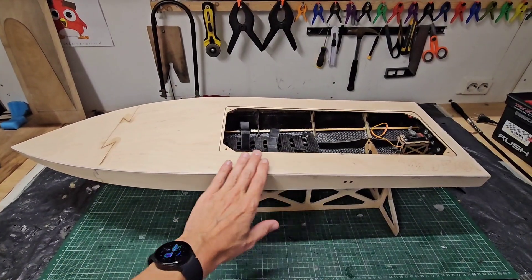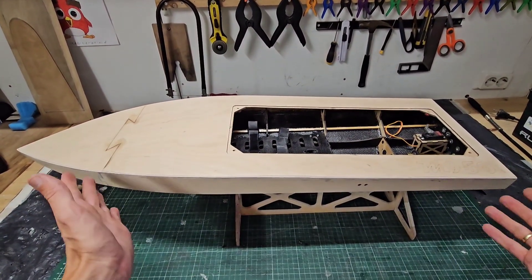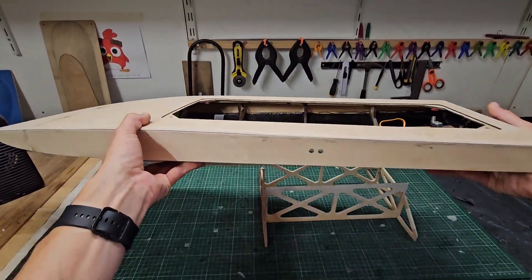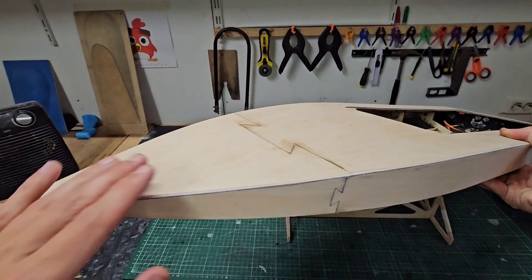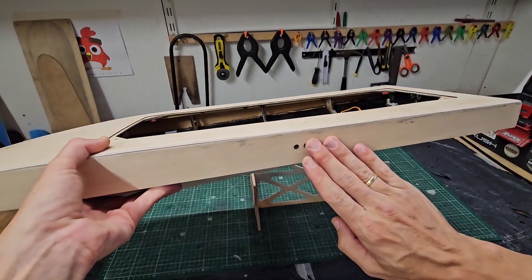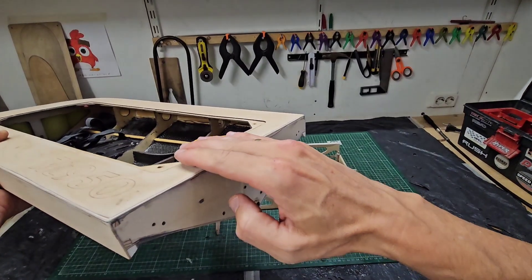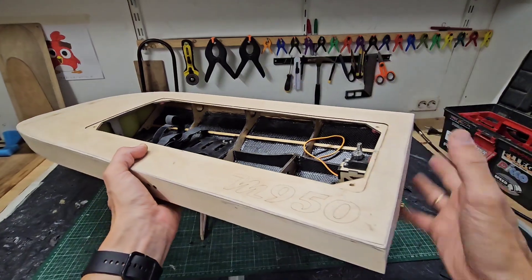It's the next day. I got the boat fully sanded — I didn't record the sanding process as it's kind of a boring process — but you can get an idea when you look at the hull, it really looks clean. I rounded the edges from the deck to the side so I can glass the deck and the side in one big piece of glass. I'm also going to use the same piece of glass for the transom, so I will basically glass it all in one piece.